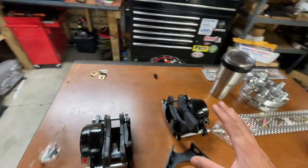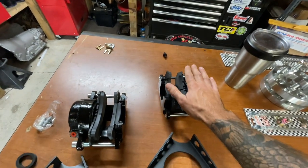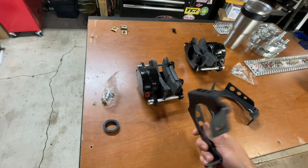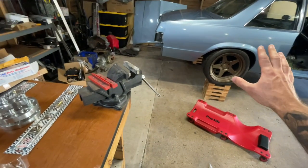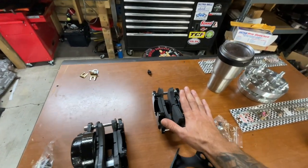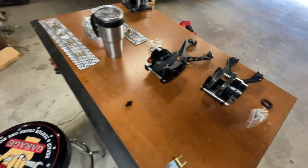I'm going to run a separate brake setup. I picked up another set of these GM big bore calipers — commonly used on rear end disc brake kit swaps — and a mounting bracket. The rear already has a disc brake setup with calipers that have the parking brake, but these ones don't, because you don't need that with a hydro brake.